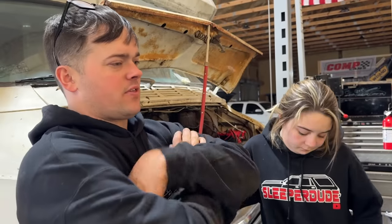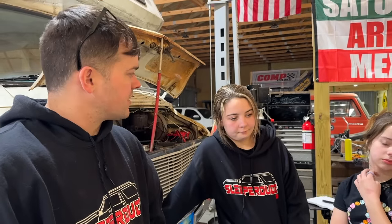I went back and forth about whether or not to put a rear main in it, because I didn't feel like I could do a better job putting the rear main in from the bottom with the crank in the motor still. I did the best I could the first time. Apparently it was just my oil pan gasket. Maybe it was that mismatch with the pan gasket, but it was leaking at the rear, not the front. Maybe I just didn't get enough sealer on it at the corners. I think we've got it fixed.